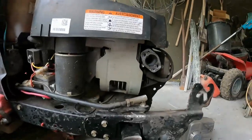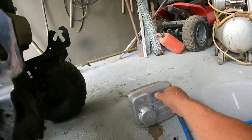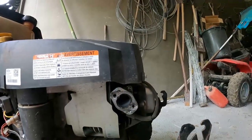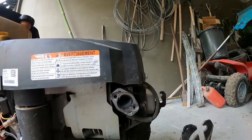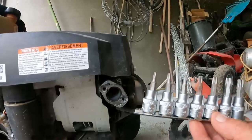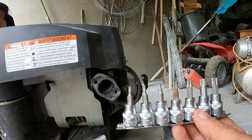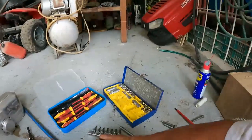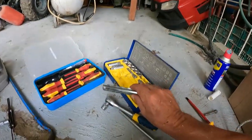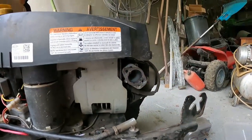I noticed she was very noisy this morning again through the muffler. What happened was I had to take this outer piece off. There's got a little manifold here and that was loose. I had tightened it up before with Allen keys, but it mustn't have been tight enough. I remembered I had those ones from Andrews Martin that he sent me from Germany. And bugger me dead, they fitted. With those I was able to get onto the ratchet and tighten the shit out of that bastard. I'm very pleased — thank you, Andrews Martin. So this is now tight as.